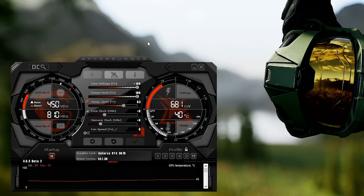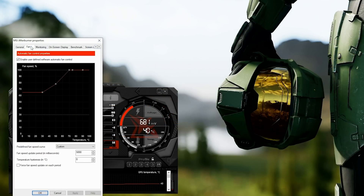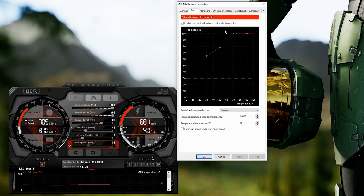Next, we're going to move on to memory clock. One more thing before that: the custom fan speed. If you see the little gear icon and click it, it brings up the fan menu where you can set a custom fan speed curve to get better cooling performance out of your GPU, though it will get a little bit louder. You can move it around and set it up how you want.